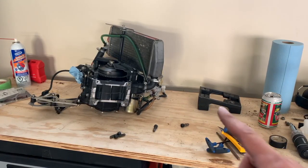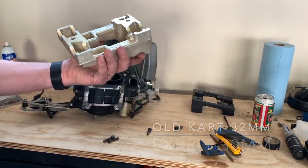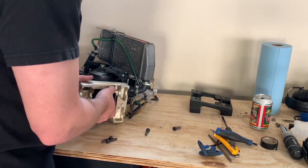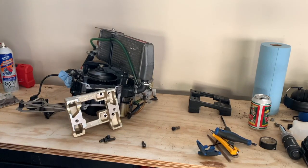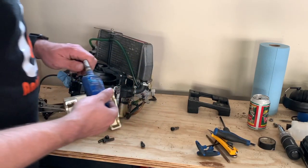You can see the old wedge has come off and we're going to get the new wedge on. The reason is because there's a millimeter change on the chassis — the diameters are a little bit different. Before I do this, we've got some blue Loctite.